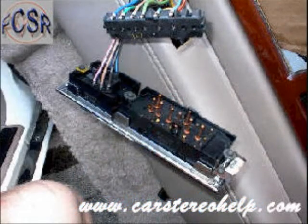When prying these connectors off the control panels, be sure the battery is disconnected or use a plastic pry tool. There are usually clips on each end — pry each end and go back and forth to get the connector to lift up. This connector is keyed, so it will only fit back in one way.